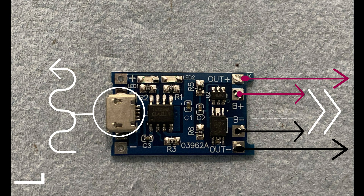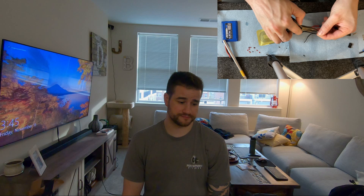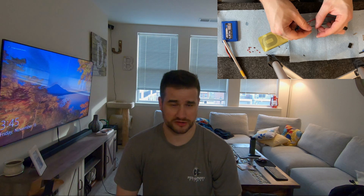Here's a circuit diagram showing how I wired the circuit up in order for it to work. I ran into a problem after I installed the circuit — the radio wouldn't turn on. After trying to find out why for what seemed like an hour, I finally busted out the ohmmeter and discovered that the three-plug connector, the male connector I had spliced the metal inserts and pins for, wasn't getting a good connection. So I wasn't actually getting a solid connection going to the radio. Once I discovered this, I wired the circuit up the way the diagram shows, plugged everything back in, and it works — it works great.